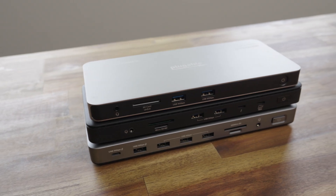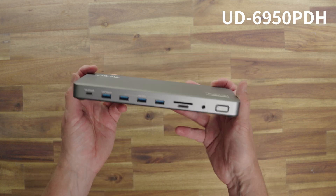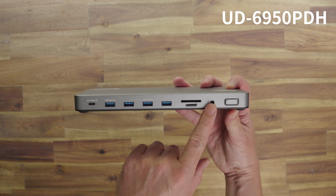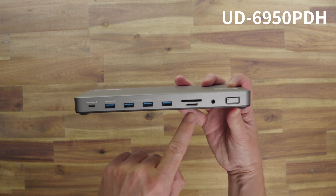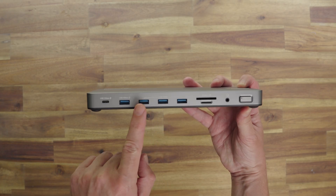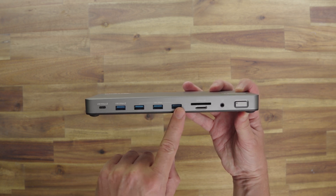There's a range of different options price-wise, going from $200 to $300. Some have faster USB ports and some don't, and up to four 4K displays can be supported by one of these. Looking at the UD6950 PDH first: this is a nice slim build with a metal top and metal surrounds for durability. On the front you've got a power on/off switch, a headphone jack, a card reader for SD and micro SD cards — read speeds of 312 MB/s and 108 MB/s respectively — and three USB-A ports capable of 5 Gbps transfer speeds, plus another one that also provides power at the same speeds.